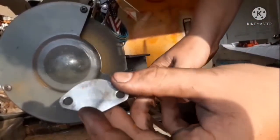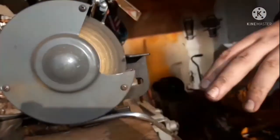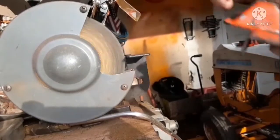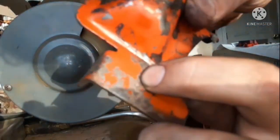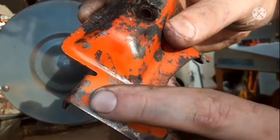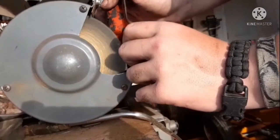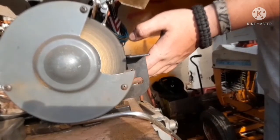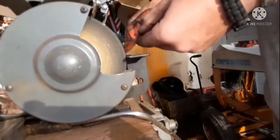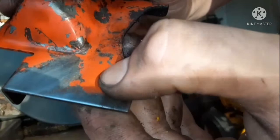And see how that's all nice and clean? Here's a tip: if you're sanding and you notice it's chipping, like if there are hard edges here, I'll show you. Say I sanded here a little bit, but you notice there are hard edges right here? If it's still doing the hard edges, it's not good. You want it nice and smooth, like a fade. I'll try to show it. You notice how under here it makes a fade into it? That's genuinely what you want, because the parts that are chipping mean it's going to strip there eventually.